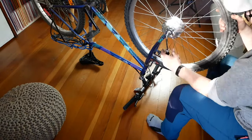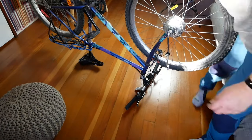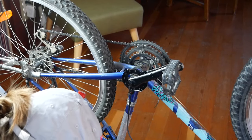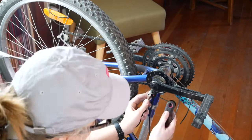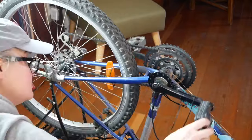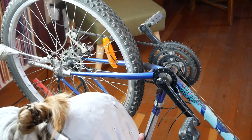Switch also supplies rubber caps that you can place over the nuts on each side. Since the Switch kit turns your bike into a pedelec — meaning a pedal-assisted e-bike — it needs a way to tell whether you're actually pedaling. That's why it comes with a pedal sensor and magnet disc. The magnet disc attaches to the crank axle on the opposite side of the chain using zip ties. The pedal sensor sits on your frame and faces the disc. I lined the sensor up with the silver dot on the disc, and the gap between the two should only be 0.1 inches or 3 millimeters. When everything looked good, I secured the sensor's cable with zip ties.